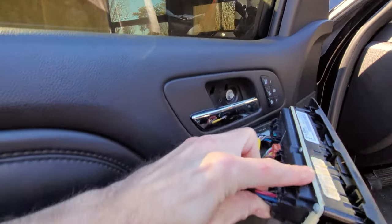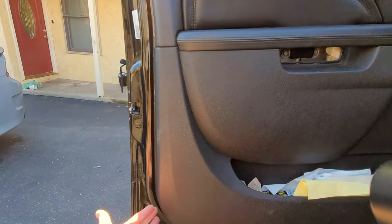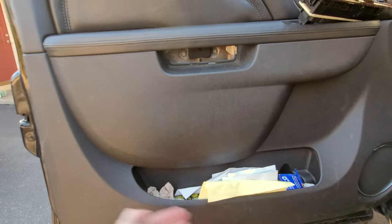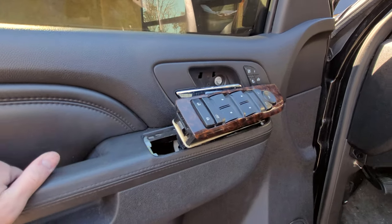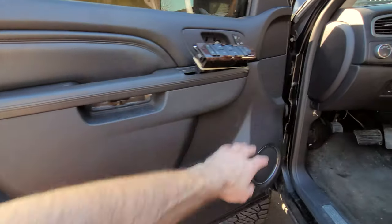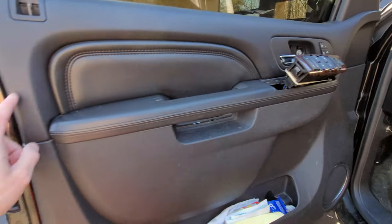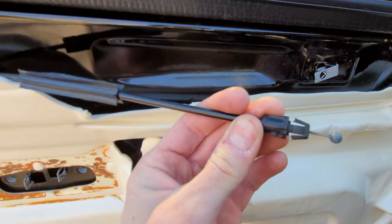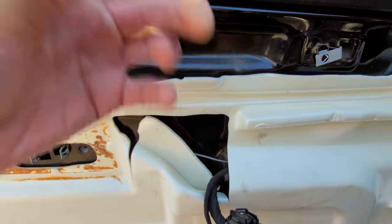I'm going to remove these three bolts, disconnect this, and then use a plastic pry tool. You're going to put it in the bottom corner down here and pull forward, then move your way over and pull forward. All these should snap off and you should be able to pull the rest of the door panel off. Typically on these trucks, I don't see a lot of clips breaking. If they do, it's usually one or two of the white ones over here. The blue clips on this side don't seem to break ever on these trucks. You might get one or two white ones that break. Alright guys, the door panel is off. This piece right here — put a flathead screwdriver in, pinch these two tabs, this will pop off the door, and just pull the ball out. Make sure your tabs are all in place. On these corner covers for the mirrors, you're always going to have a tab that breaks — every truck I've ever removed these on, at some point a tab will break. You're going to have to buy a new one of those, which is typical.